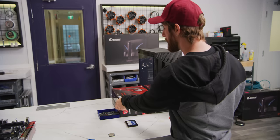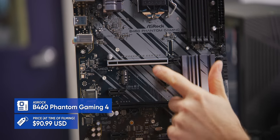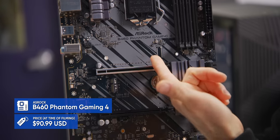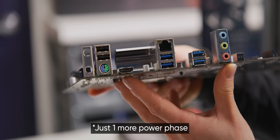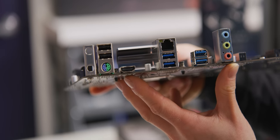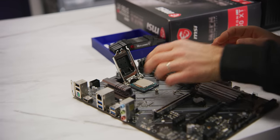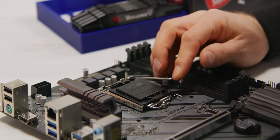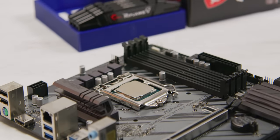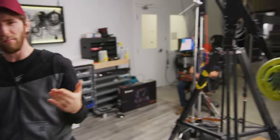For example, our motherboard. We could have gone with the H470 Phantom Gaming 4, which does have another M.2 slot, a couple more power phases, as well as slightly better USB connectivity, but because that didn't give us any overclocking potential, and stepping all the way up to a Z-series chipset wasn't in the cards at this price point, we decided to save the 20 or 30 bucks.